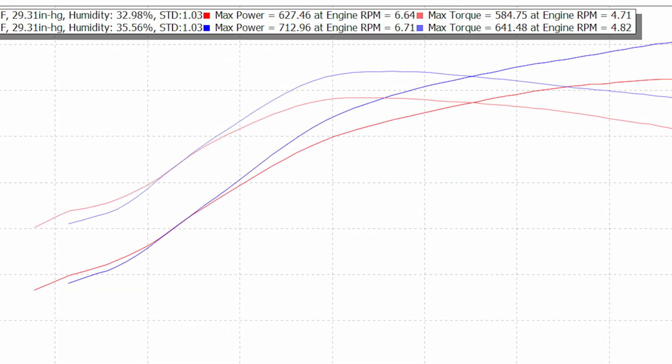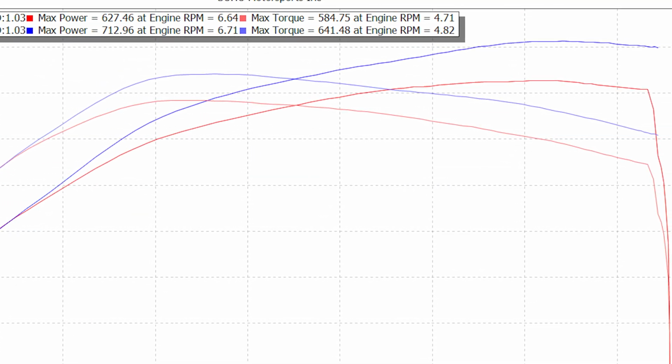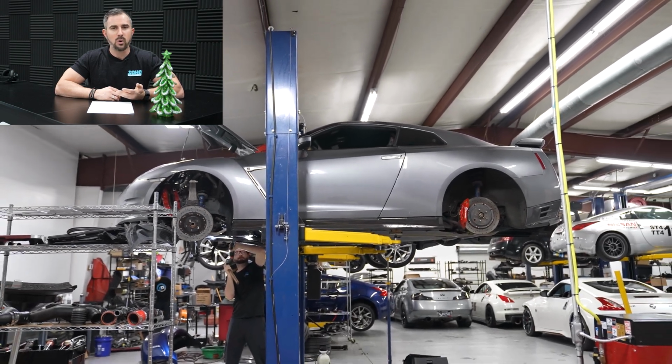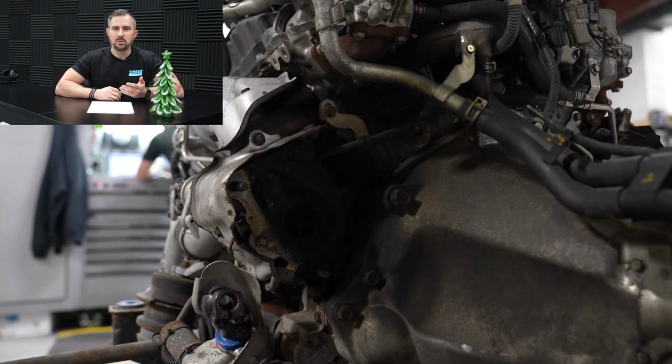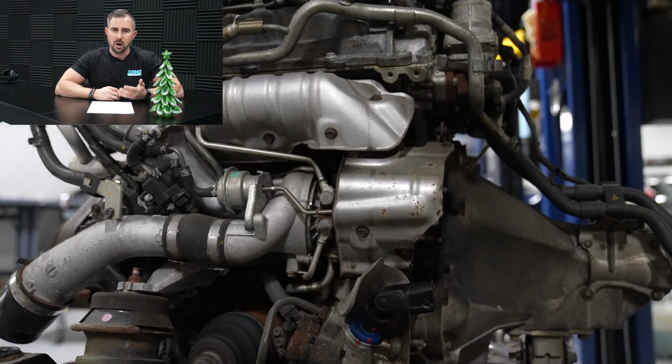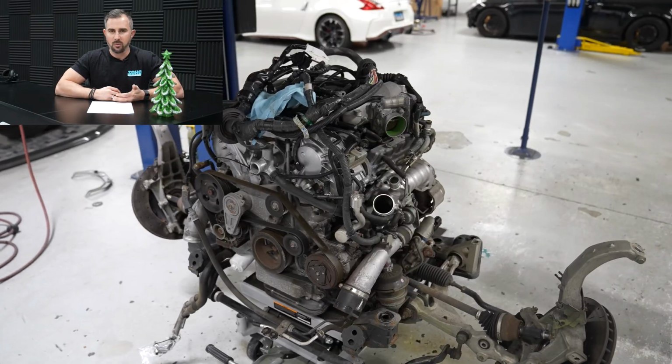That is going to be great power. Look at the power band, how nice it comes in and how it carries. Normally on GTRs, they'll come in, hit real hard, and fall off on the top end. Upgraded turbos won't do that. Even in the Qs, you upgrade the turbos, you're going to have the same kind of concept where you have power pickup all the way to redline. So upgrading turbos is always good. You keep torque low, you make more power.